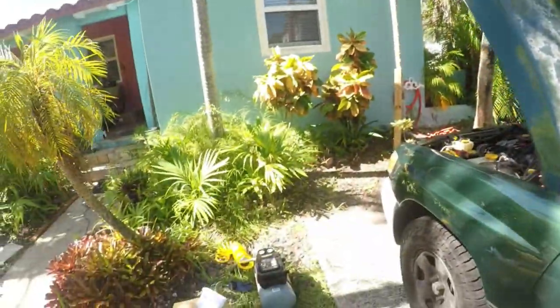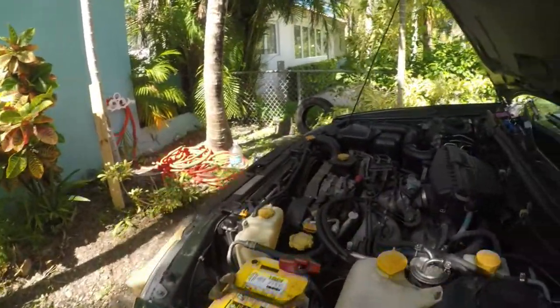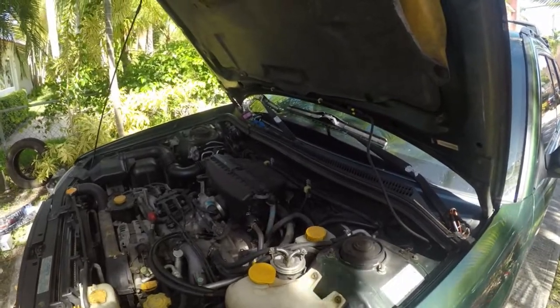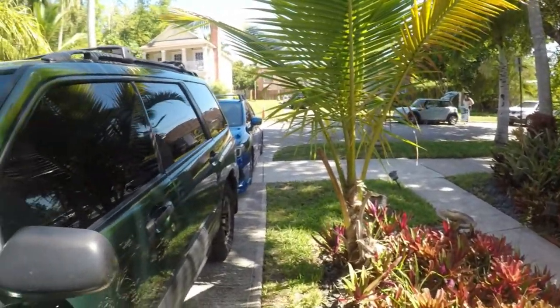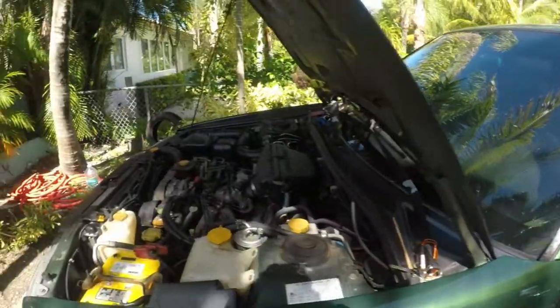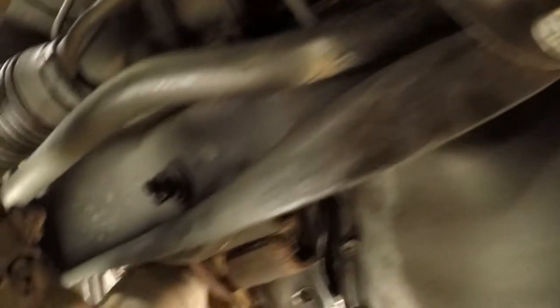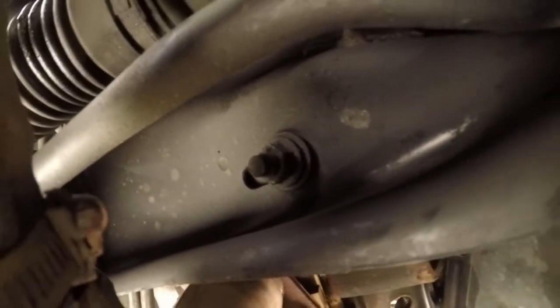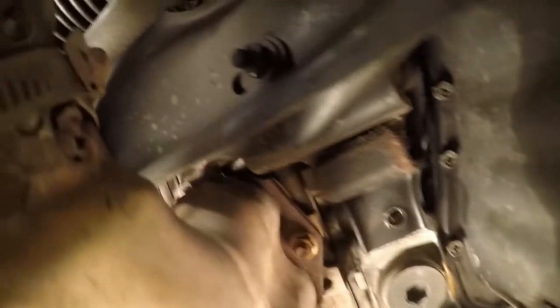It's a little too tight down there so we're gonna jack up the car. We managed to get two of the motor mount bolts off, but the other two are way too tight. So we gotta pull the header off — I'll show you guys that in just a sec. Now that we have a little more space, let me show you — here are the bolts I got out. I still have to get the one that's attached to the subframe, but unfortunately the angle in which it's located means I have to drop the header.